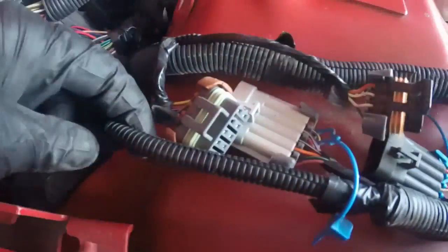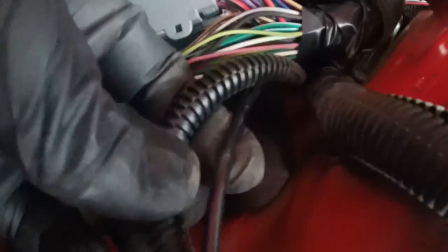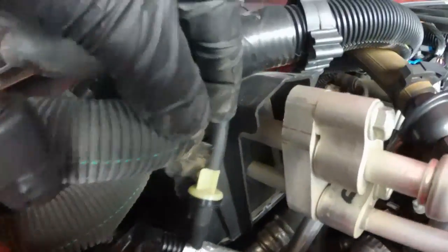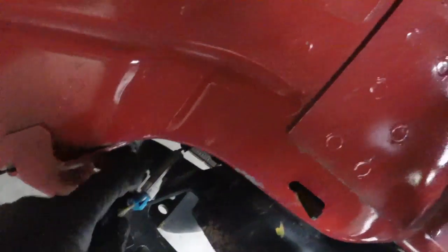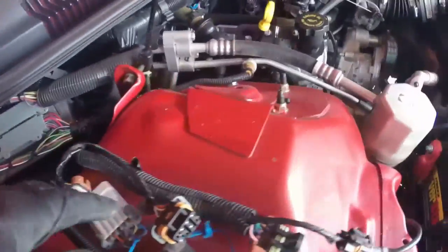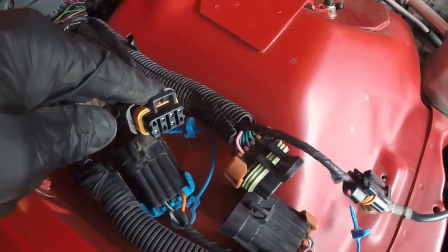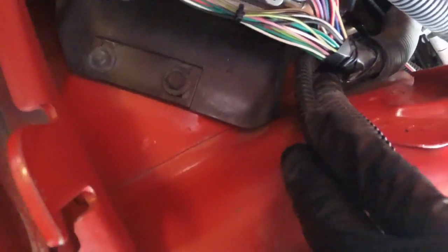There's one wire we can unplug up here — that's a vacuum line, and there's also a wheel speed sensor. The vacuum line just goes to the top side of this, so we need to unplug it. The wheel speed sensor goes down the inside inner fender and comes to right here, so we need to unhook it here, unplug it, and fish it back up all the way to the top. This is going to give us the ability to run all this stuff on the bottom side of the fender under the liner like it should have been to begin with, instead of having this mess of wires up top. To do that, we're also going to have to drill a hole right here, and I'll show you that in the next step.